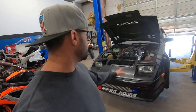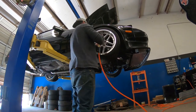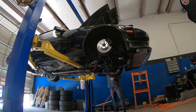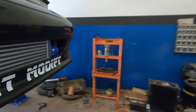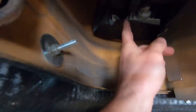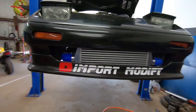Enough of the rambling — we're gonna go ahead now and take off this front bumper cover, expose it all, mount that radiator fan, and get things wired in. With the wheels off and everything exposed, you have four studs right here — one, two, three, four. Take those nuts off and it's the same on the other side. There's also a connector for the turn signal right there, and some bolts up top.